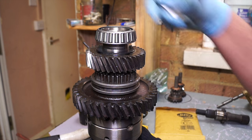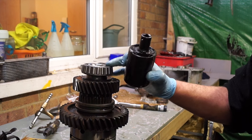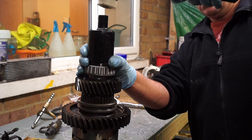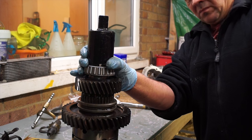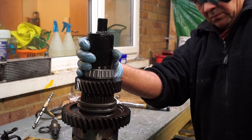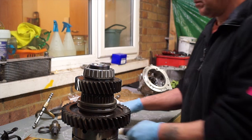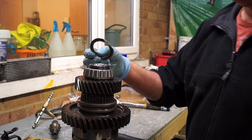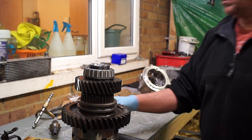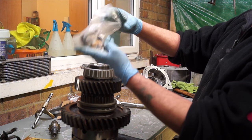The rear part is the one that has the screw thread on it. To fit the bearing you need a piece of tubing like so — this one just fits — and you're driving the inner part of the bearing race. Do not hit the cage at all, otherwise that will distort. As Land Rover recommend, just drive it into place. So the bearing is fitted on the rear part, and then you have your nut here — that's actually the wrong way around so we're going to use a new one. That also comes in the kit. Always fit new, because these are staked as well.